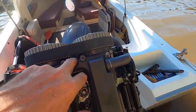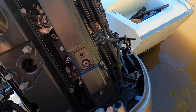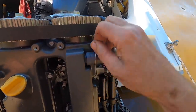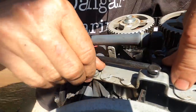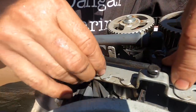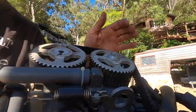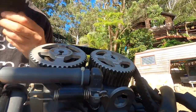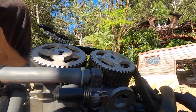Alright, let's get this rocker cover off — it's one piece going across the exhaust and inlet side. The tricky ones are going to be the 10mms down here, but they don't look too bad. Take this rocker cover breather hose off. I'm just taking this bracket off to give myself access to the bolt through the top of the timing belt tensioner pulley. Alright, let's see if we can rattle these cam pulley bolts off. Wasn't too hard. Very good.